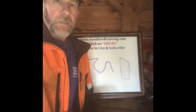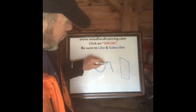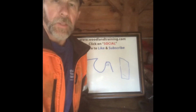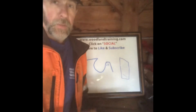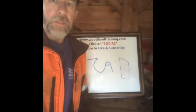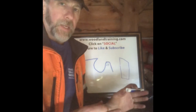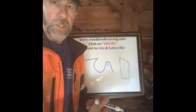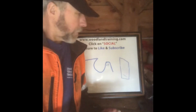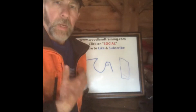Let's throw a number at this. New saw chain, right? 25 thousandths of an inch. Most chains, I know Oregon chain, they got a little 25 stamped right there. That's what it's telling us right out of the box, 25 thousandths. And most of us who work for a living in the woods with saws know that that's not thick enough. That's just where the factory sets it. It's kind of a rock and a hard place between a chain that can cut some, but the lawyers don't want the chain to be cutting too aggressively, somebody gets hurt with it. We file them down.